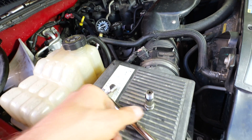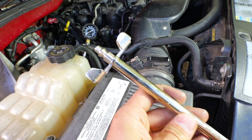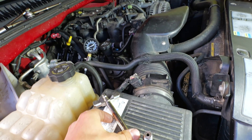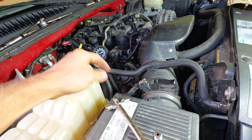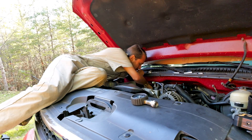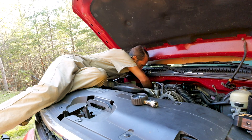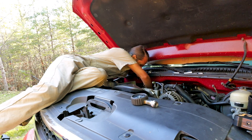That really flexible hose is hard to get down in there. Sometimes you can get an adapter like this — screw it into the spark plug hole and pop the compression tester on the end of it. It takes a long time to go through eight of them with that flexible hose, getting it in there, getting the threads started. This is rough work down in here, man. Getting that back cylinder — there's no room. You got to keep fighting with it to get it in there, but I finally got it in.